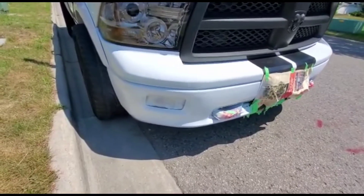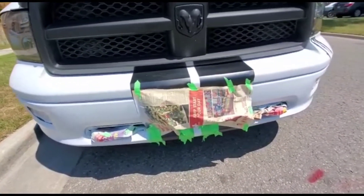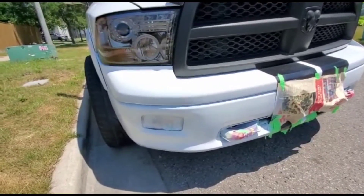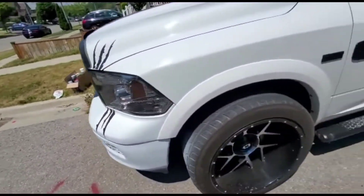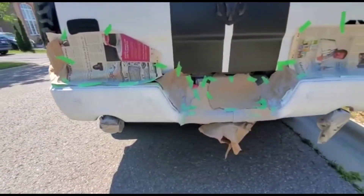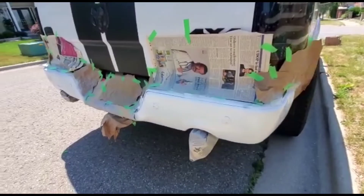This is how it's looking after two cans of Plasti-Dip. I have one more can, so there are still some areas to touch up — I'll let it dry and come back to it. You really need to give it a couple of coverage passes. This third can will give me maybe two more passes on the front and two at the back. Right now it's just looking matte white — after I put the glossifier on it, it should bring out the sheen. I'm going to give it about two hours and come back with two more coats.